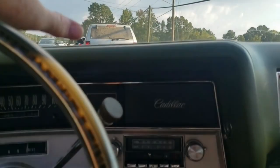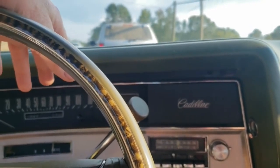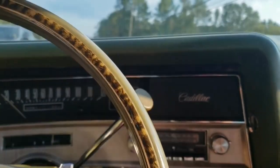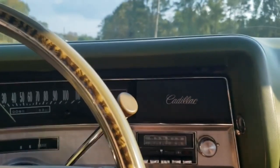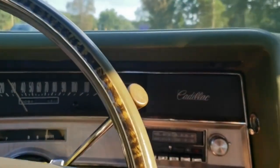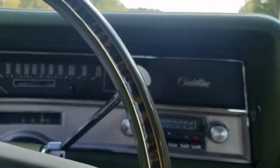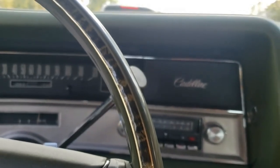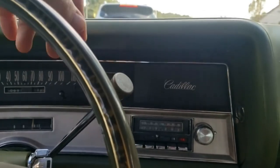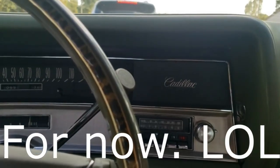Last night, I did quite a bit of test and tuning on this old car. I went back to a ported vacuum advance setup and tuned it more like a stock setup, and took it out for a little test drive. It might have been subtly minimized, since there was no vacuum advance at idle. Sitting at a red light, the miss was still there. It might have been minimized slightly, I couldn't really tell, but bottom line, it did not address the issue. But I did try the suggestion, so I put her back to full manifold vacuum timing advance.